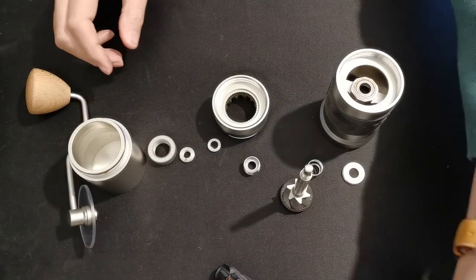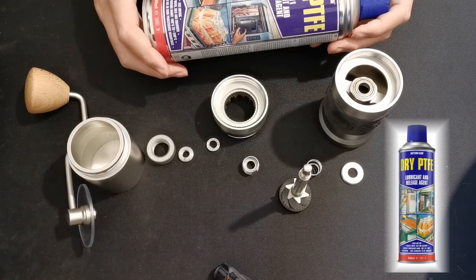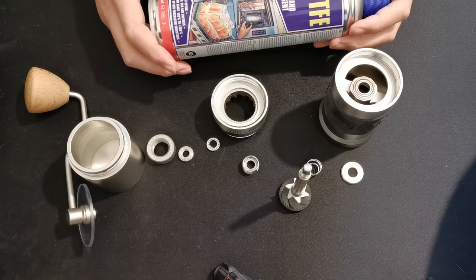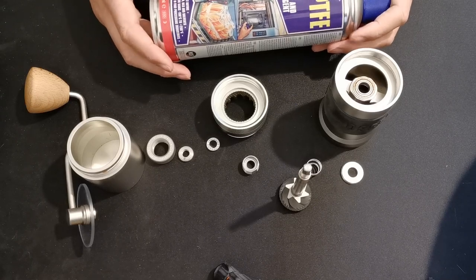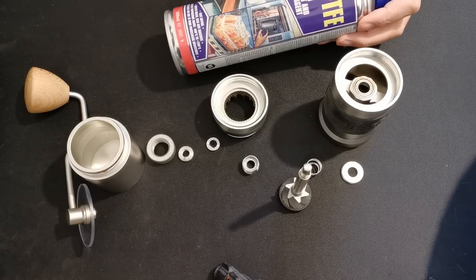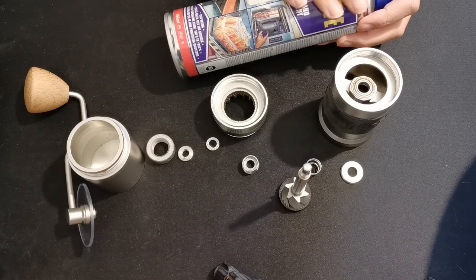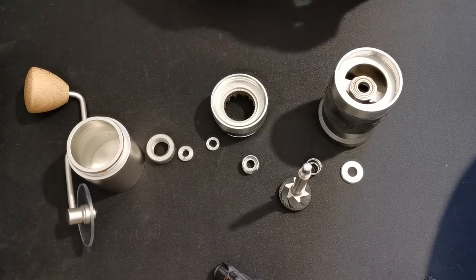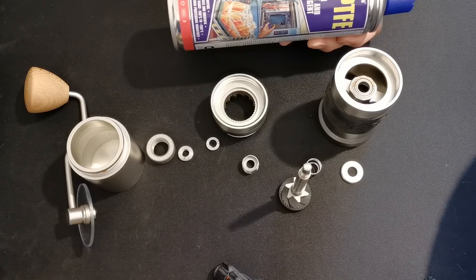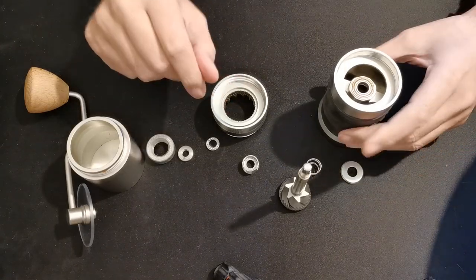What I didn't talk about when I dismantled the JX was lubrication. I use this product — it's called Action Can Dry PTFE, NSF-H1 certified food contact safe, made by Ambersil. They bought Action Can some years ago and they make some of the best food grade lubricants you can get. Dry PTFE is particularly good because you can lubricate without leaving anything for coffee to stick to. Go onto the Ambersil site and look for dry PTFE — it's not cheap, around £15–18 a tin, but it has loads of uses in coffee machines and grinders.